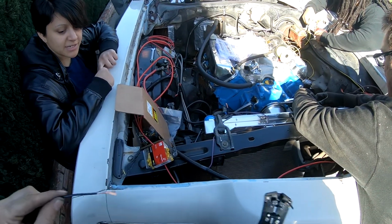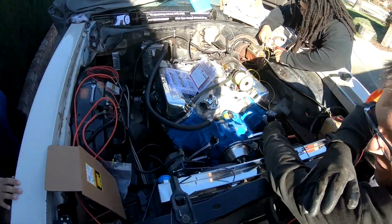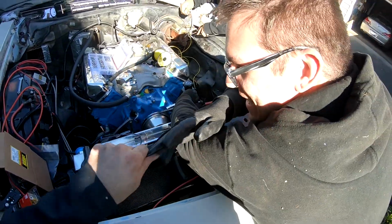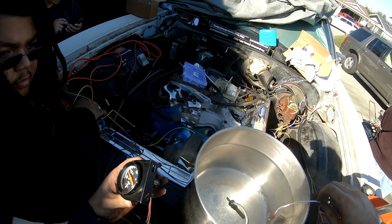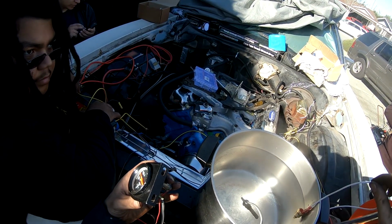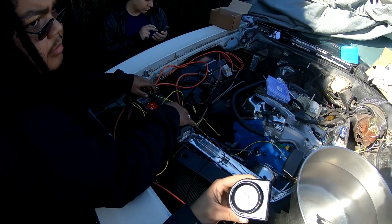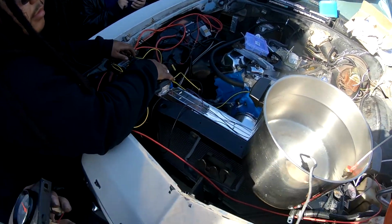Solder. Your car's gonna be heck of sick when it's done. You take this glove off, it's not working. Torching could be bad. You don't want to, that's extremely hot. You don't want to damage the sensor. Is it 180 thermostat or 190? 180. So it should fire on now that it's at 180. Should. But it's not.